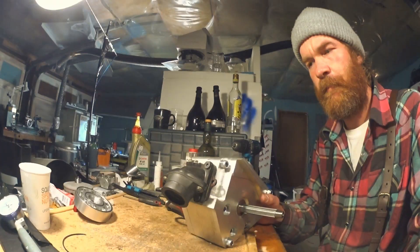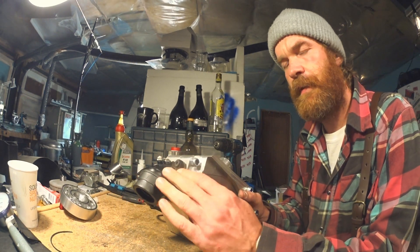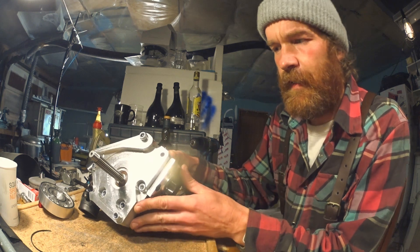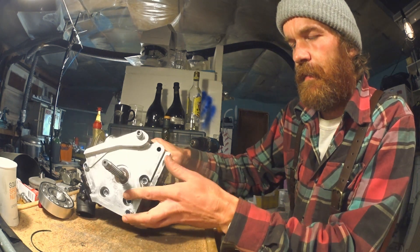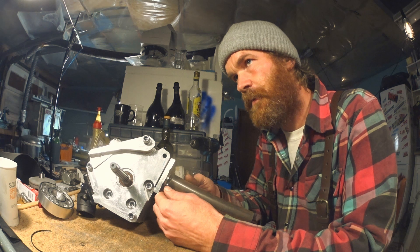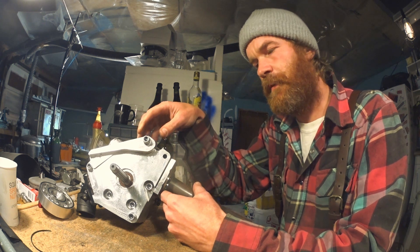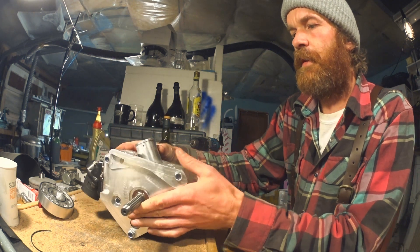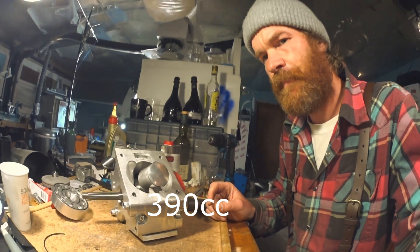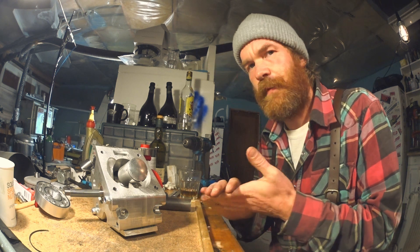The intake I've been running up until now — this intake with a carb — is the primary intake with a reed valve. That's for starting and bringing it up to RPM, warm-up, stuff like that. Then this secondary intake will take over and it's going to be tuned. Imagine a long pipe approximately 130 millimeters long — that's to tune the intake for the volume in the crankcase. The crankcase volume is exceedingly large for 50cc — it's 490cc. That gives a primary compression of 1 to 1.17, so that's low.